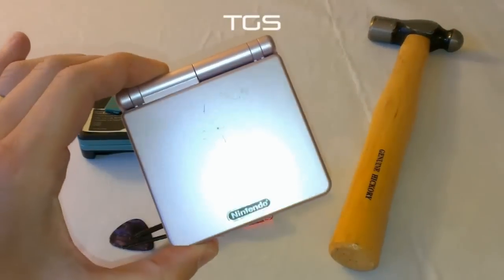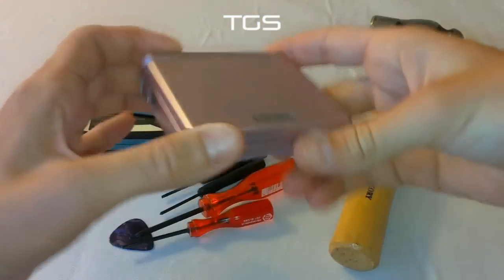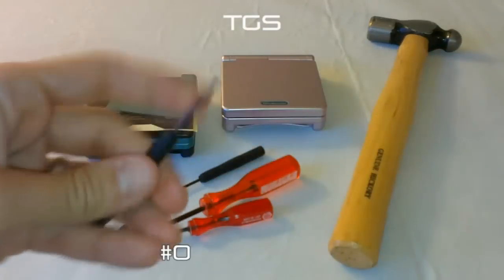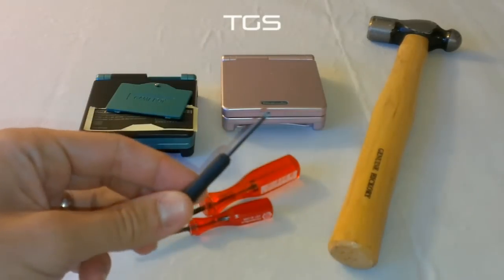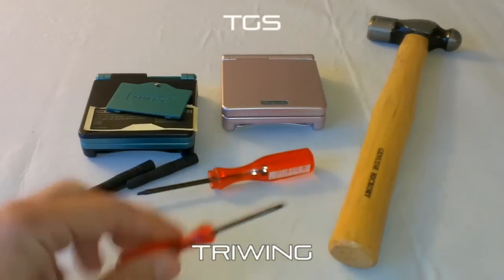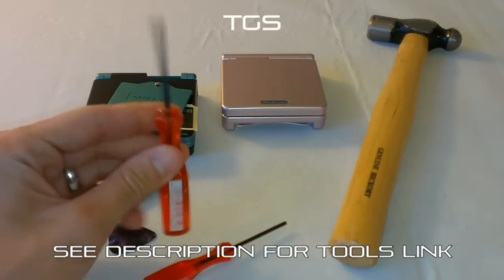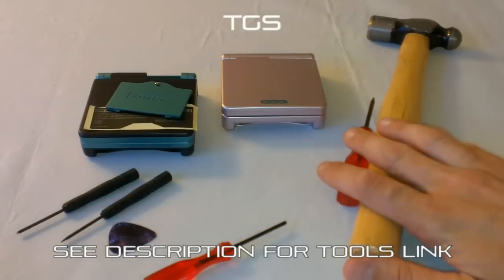What we're going to do is use this pretty mashed-up pink SP. It's not too bad but as you can see it's all scratched up around the edges — lots of marks, pretty bad. So I'm happy to take this apart and replace the housing. The tools you're going to need are: a very small Phillips screwdriver, a small flat head screwdriver for prying the plastic, a tri-wing screwdriver, a little guitar plectrum, and a fourth screwdriver and a hammer which will come in handy later.